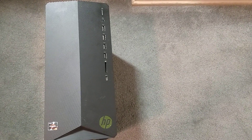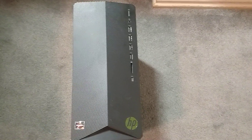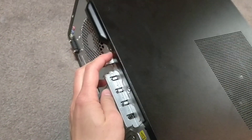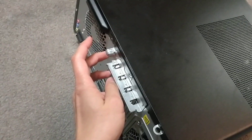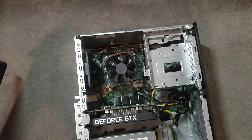Let's take a look at how to install a hard drive on the HP TG01. Tip it over — there should be a screw right there, not really sure, it didn't come with one. Unscrew that, then slide it off. I already took mine out and I have a few screws already missing.